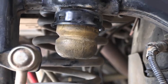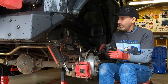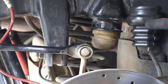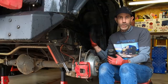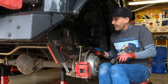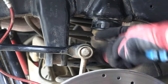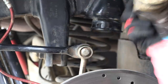Just so you guys know, full disclosure — I've actually been running these things and pulled this one out and put the stock one back in just to show you the process and give you a better idea of what you're looking at comparison-wise. The fronts are a whole different ballgame because they're inside the coils, but back here you can see they're right here. To get them out, it's fairly straightforward — I use some channel locks and you just twist and pull, and that sucker will come right out.